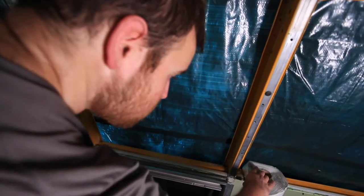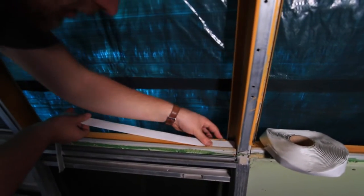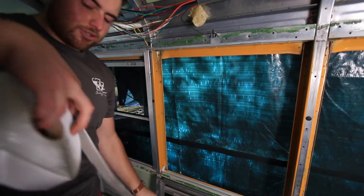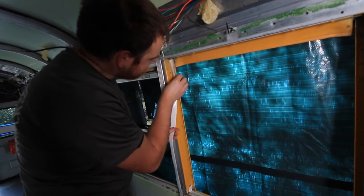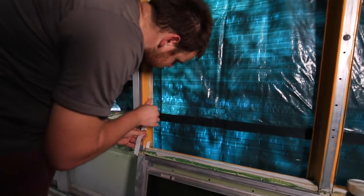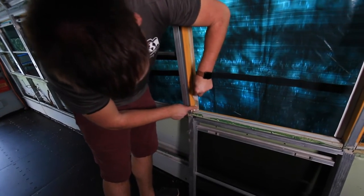You just kind of measure it out. The nice thing is with it being so putty-like, you can just tear it apart. Basically all you do is come in, make sure you've cleaned out your track, and put the butyl tape down there — being careful of the dam so that you're not getting it too high up. I'm just giving it a rough measure, eyeballing it, because if there's extra we'll pack the corners. Same thing up top — press it in real tight. As I go down the sides, make sure you can see a little bit of the butyl tape on the edge so that when you put that window in, it'll really pinch in there and seal it well.